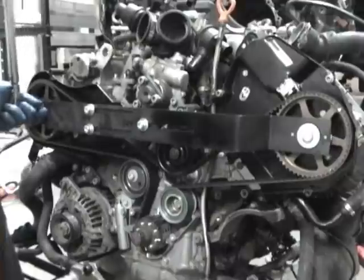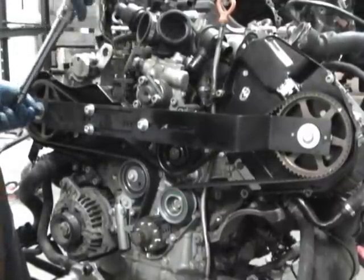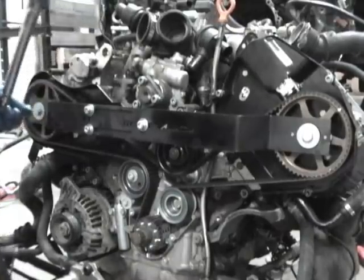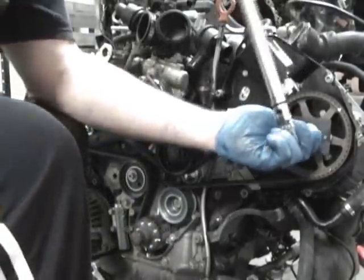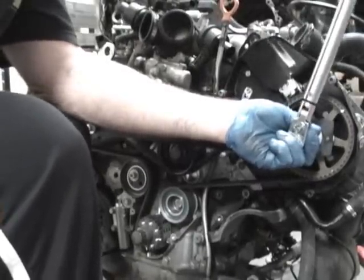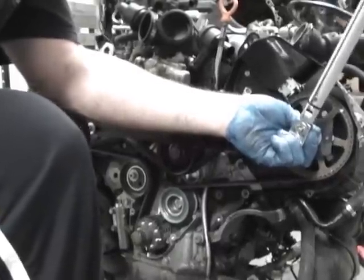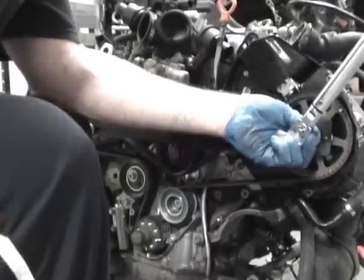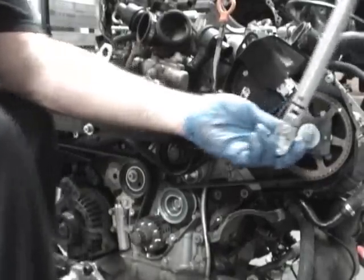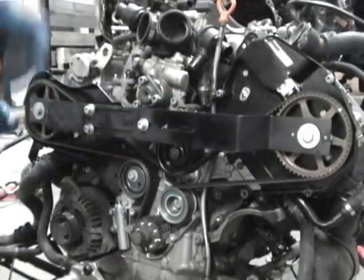When I was putting extra tension on the belt, I was going in the loosening direction. Normally you don't want to do that with a click type torque wrench. You normally would want a torque wrench that has a little gauge on it to help you do the 15 newton meters or 11 foot-pounds. Or you can just do it by feel if you feel comfortable. But there, that's 40 foot-pounds, 55 newton meters.